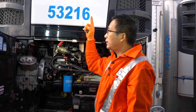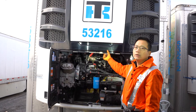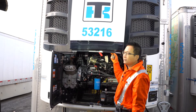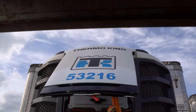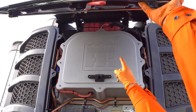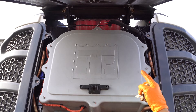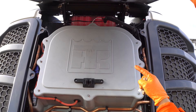Then we have to check the coolant level. The coolant bottle is up there — you cannot see it until you open the top hood. This is a new unit; some old units you still need to open the top hood. So we open it — you don't need to open it all the way up. If you stand above your truck, just open it a little bit, enough to look at the top. You'll see the coolant bottle with the red coolant inside. As long as it's full, that would be fine.